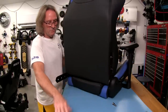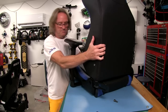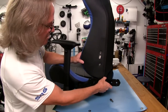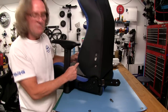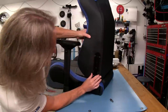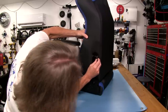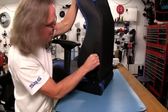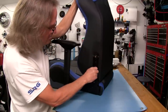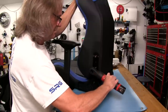It's a lot easier to do when you're not shooting video, as you might imagine. Now we've got the seat sitting here, and as you can see this bolster — if I had that hinge up — would be hitting it because it kind of comes out at an angle. So much easier when we just slide it up here. Now all we have to do is find our holes and make sure we have our washers on when we put our bolts in. Sometimes this vinyl gets in the way and can be kind of a pain to find the hole, but being on a bench gives me a better angle.